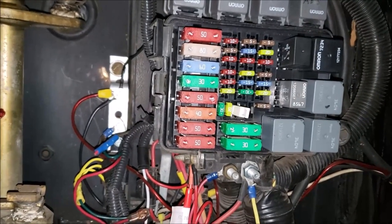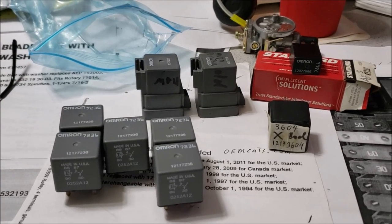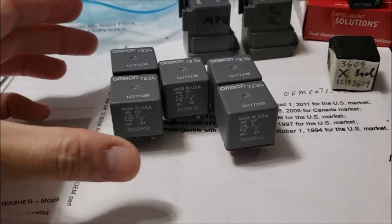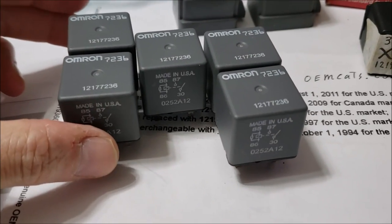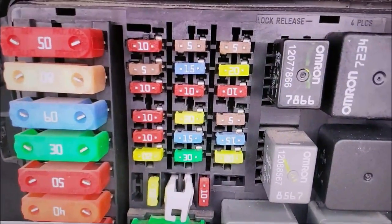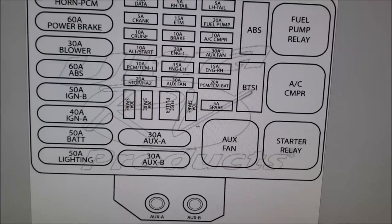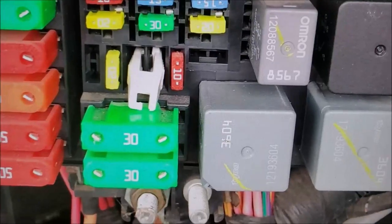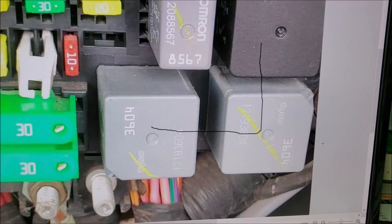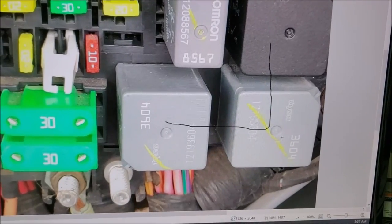Anyway, now I've learned something today — that's always a good thing. So I finally made it into the house and I've got a little bag of relays here that I carry with me. I've got like five of one particular number. These three relays are all the same part number — and that's the one that had failed on me: the starter relay. I had that one fail on me and I had a no-start condition.